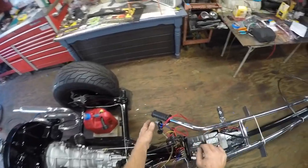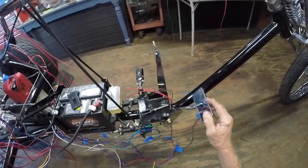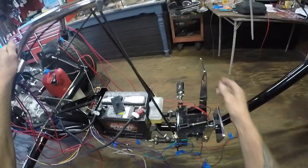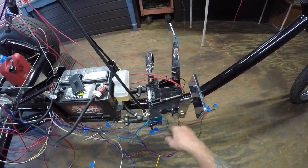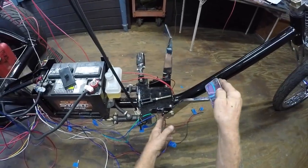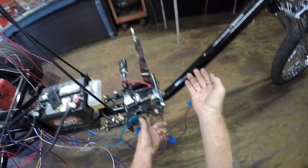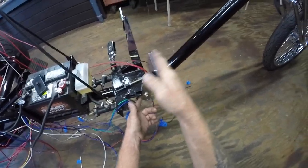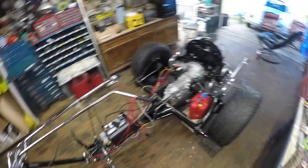Right now I've got my light switch here but I don't have it hooked up yet. I still don't like that there's nothing to prevent the pedal from going too far - on this side you could push the slave too far past the o-ring and it'll leak. I'm going to have to weld a bracket underneath here and have an adjustable bolt with a locking nut to stop the travel. I can't really judge the full stroke until the body's on here to see if the pedals hit the body or clear it.